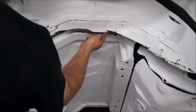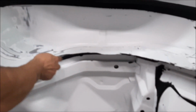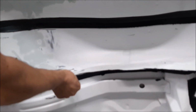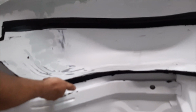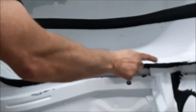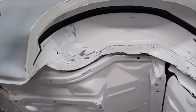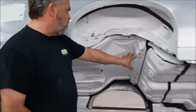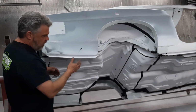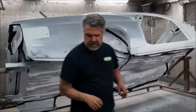And then they do this by hand, which looks kind of funny right now, but where the two new pieces of metal were put together, we've got weld-through primer on both sides before it was repaired, but then they always like to seal off that edge with a seam sealer. So this is a commercial grade product. Now it's thoroughly dried, and it's going to be ready for receiving the coat of paint along the bottom.